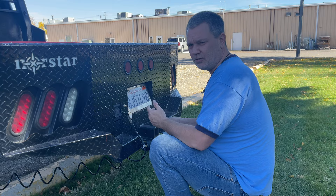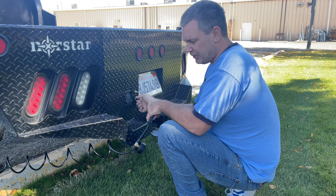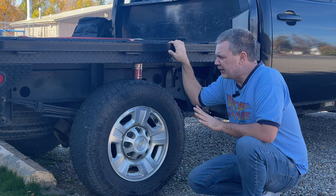I didn't see a need to go buy an onboard air compressor for that little air needed — this system is just so much more simple. You're going to spend under $500 doing this yourself. These are 7,500-pound bags, so that's going to really increase your payload. This is the truck's stock ride height with the bags completely deflated — I'm going to air it up to 80 PSI and show you how you get a couple inches out of the deal.